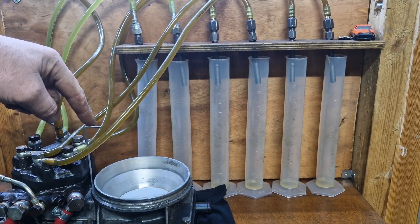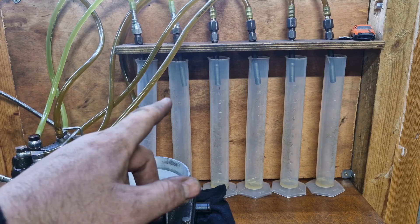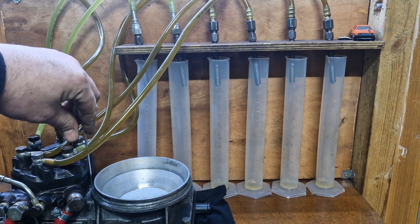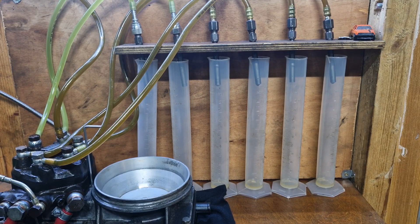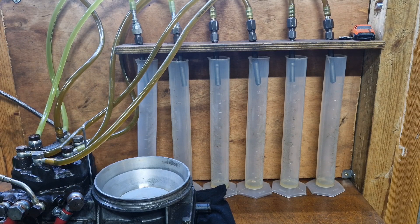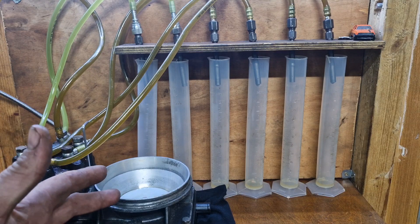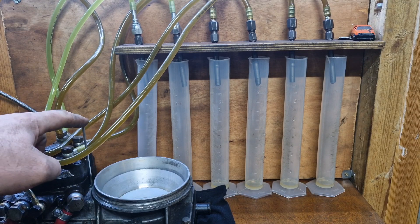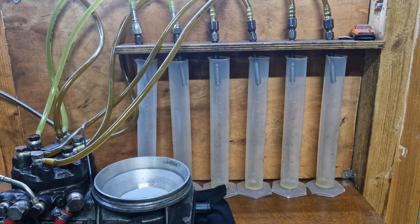The injectors are opening, so from where we are now we're going to turn it half a turn back. We can still hear the injectors chirping and fuel coming out, so now we're going to do another whole turn backwards - backwards is taking fuel away or leaning the mixture. Run the system again. There's a little drip on one and another, so I'm going to do a quarter turn backwards. We don't want any drips - nothing. Right, so that is where we want it. That is a base setting - getting your mixture screw, air plate, and fuel distributor lined up so that with system pressure in, no fuel is coming out of those injectors.